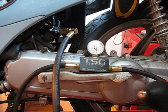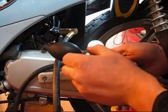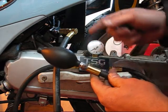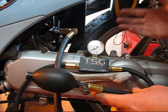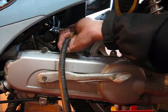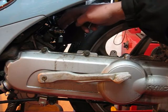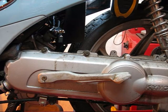We don't have to worry about the engine running lean. We'll go ahead and release the air from the leak down pressure tester by releasing that valve. I recommend that you release the air using the valve — that's what it's there for — instead of just pulling it off. Even though it's only 6 psi, it's still a tool under pressure and you need to treat it as such. You can then pull back on the collar on the quick-change adapter, remove the leak down pressure tester from the inlet manifold adapter, remove the inlet manifold adapter, remove the exhaust block-off plate, bolt your exhaust and your carburetor back on, and you're ready to go.